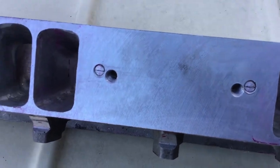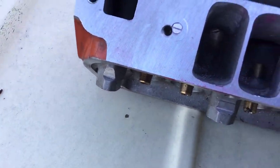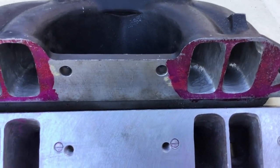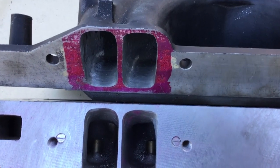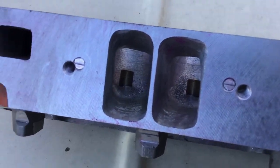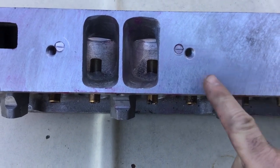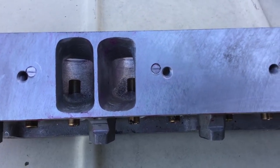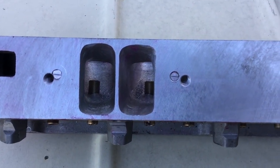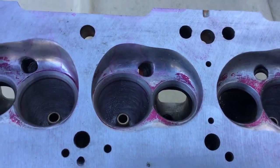The W2, of course, usually has oval ports, so I started working on this strip dominator. I'm getting there with it, still got some work to do. For that intake to fit, I had to mill 55 thousandths off this side for it to fit where I wanted it with the heads on the block and the gaskets I'm using. I did that on the old rotary broach, then just took a 5 thousandths skim cut off the surface side.